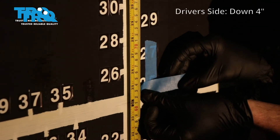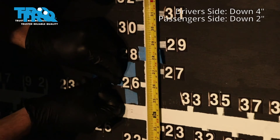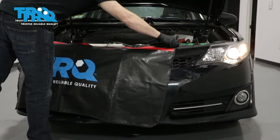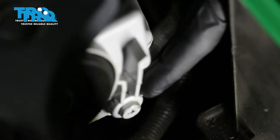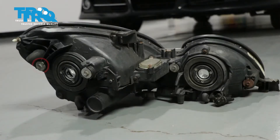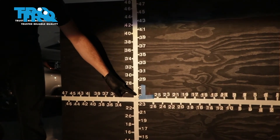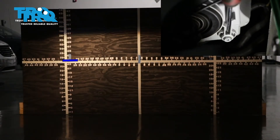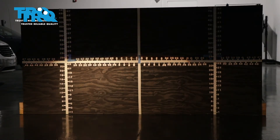We're going to go down four inches on the driver's side. On the passenger side, we have our line here and what we need to do is go down two inches. To adjust the driver's side, we're going to cover our passenger side headlamp. If you look at the backside of your headlamp assembly, you're going to see the adjustment. Some of these headlight assemblies have one, two, or even more of them, but you should at least have one. This is how we're going to adjust the headlight beam. We're going to lower the top part of the beam down to just below this line. When you turn the adjustment to the right, it brings the beam up; and if you turn it to the left, it'll bring the headlight beam down. This is the case on most vehicles.